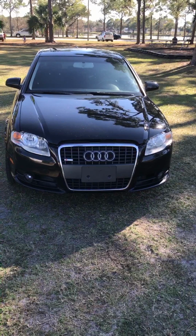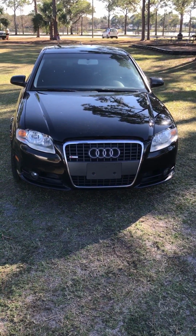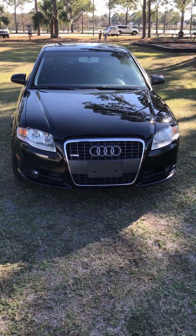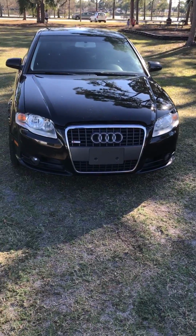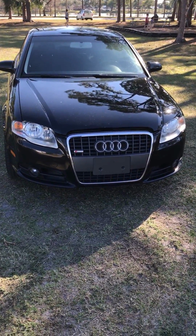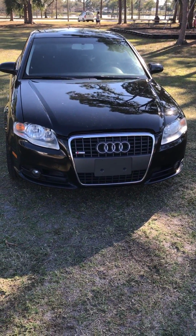Anyways, I went ahead, I read the car, and I got the code 00802: Engine speed sensor, sporadic signal / no signal. So I went on Google, I searched it up, and it is a sensor. Now, the $1 million question is, where is this sensor?